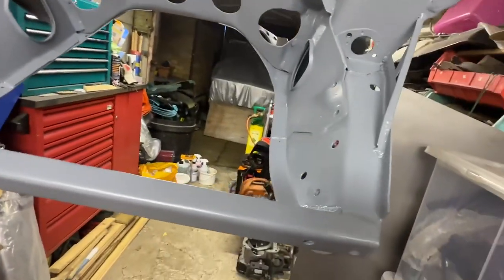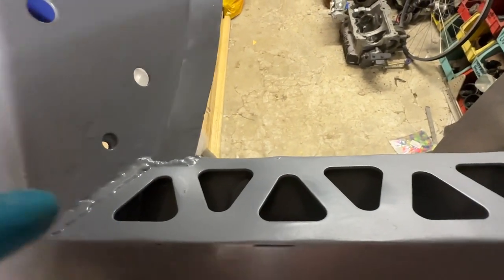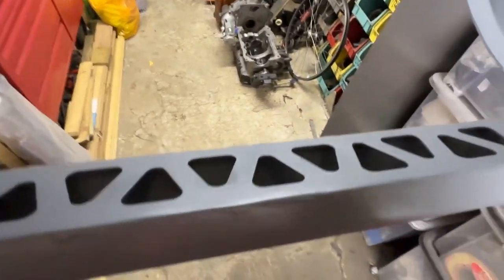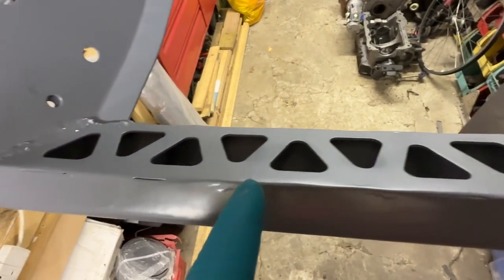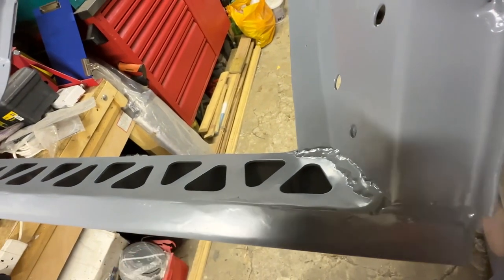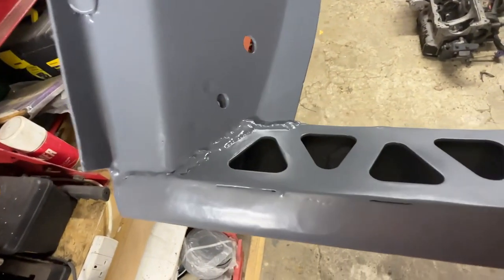Managed to get a nice amount of paint into all of the crevices. I made sure I sprayed paint down into these gaps at a downward angle and straight angle, and I've gone into the sides each way on both. This was also painted with weld-through primer before it went on, so it's not just bare metal on the back edge — it was a painted edge, and the whole inside was also weld-through primed before it was done. So yeah, fingers crossed that will now prevent any further rust from happening to the subframe.